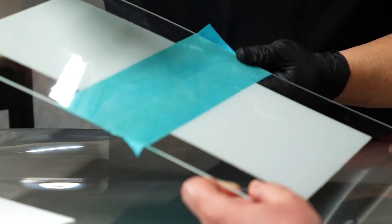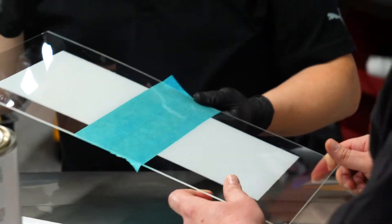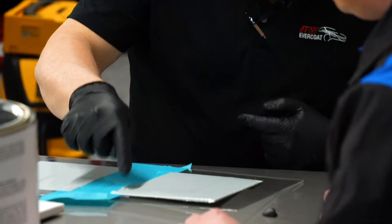Those air pockets are going to be pinholes from start to finish all the way through — there's no way I'm not going to have pinholes on that side. But on this side, I don't have any to start out with. So this application technique is really pivotal on how to not get pinholes. As we talked about sand scratch, if I had ground that area I'd have a lot more air pockets. By having extra grind marks in the metal and a sloppy initial application, those are going to start the pinhole process. And once they're in there, we can't take them back out. But if we fine-sand the surface and apply proper pressure to wet the surface, you can see how smooth it is with no air pockets working through.